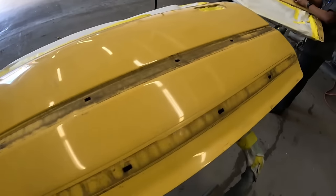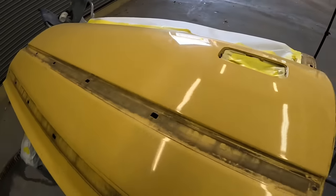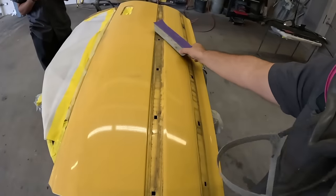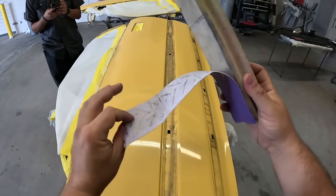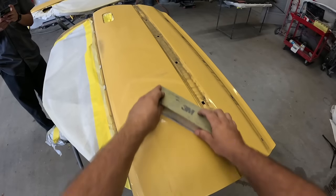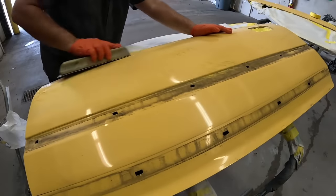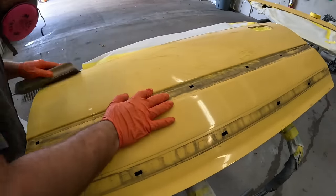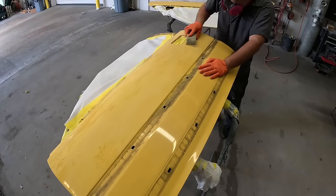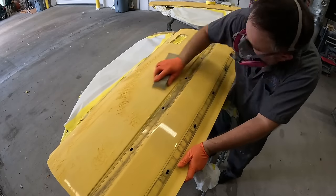You can see that everything's been properly detrimmed and we have our work cut out for us. You can see that the doors, for the most part, aren't in bad condition, but they will need blocking. Now we're gonna be using 180 grit on a 3M block. And the reason why we're gonna do this initially is because we want to identify first all the areas of concern.